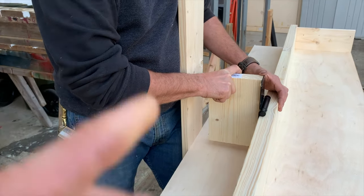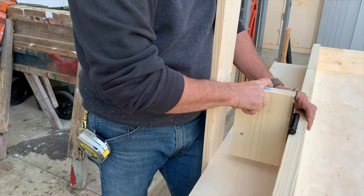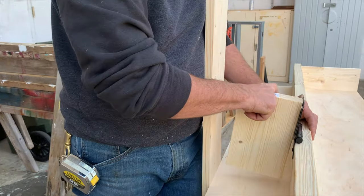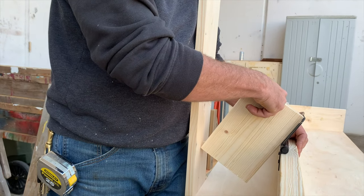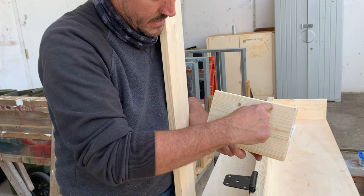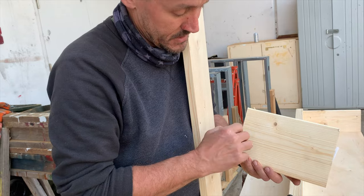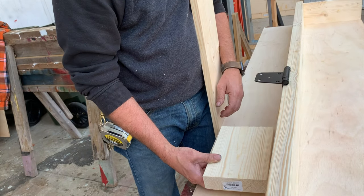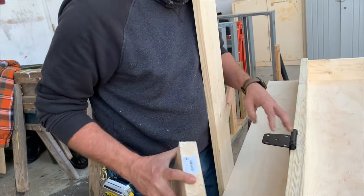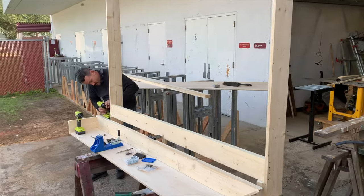So if you're thinking about doing this, this board back here represents the back wall, and this is a hinge. So the bed frame is going to be 5.5 inches thick, and when it folds up, this back hits the wall. The last part of the frame will go from 5.5 all the way around, and I'll trickle this down to 4.5 or 4 inches. The supporting frame that's in here will be 4 inches, so when it goes down in here, it will clear the back wall. So the bottom of the bed is going to be tapered, even though the mattress will be above it.